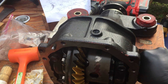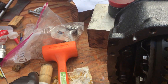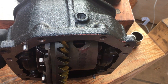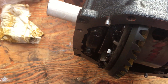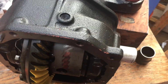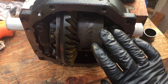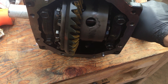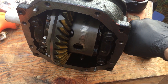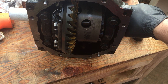This is an LSD, so when you grab it and spin it, it can break free of the input in terms of friction and coast. If I tap this rod in here and hold that side while twisting the other, they would fight — but they spin freely without the flange on. Once they get a little friction they act as one piece. It's Torsen, so there's some trickery in there. These are not fantastic for racing — Torsen isn't really meant for high horsepower or high abuse situations. There are better choices like clutch types, or going with a weld if you're not worried about tire wear on a daily.